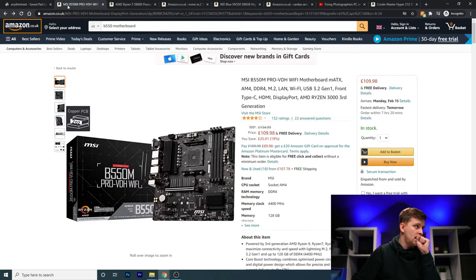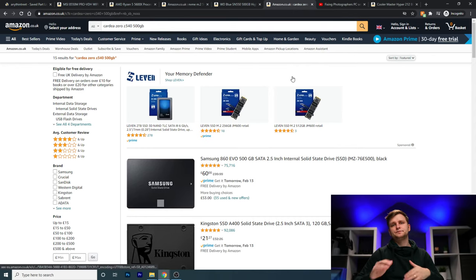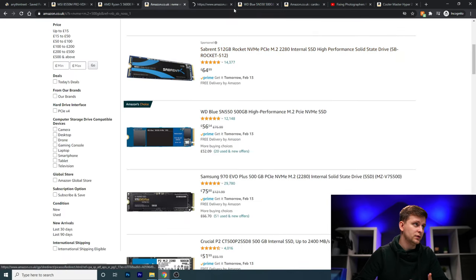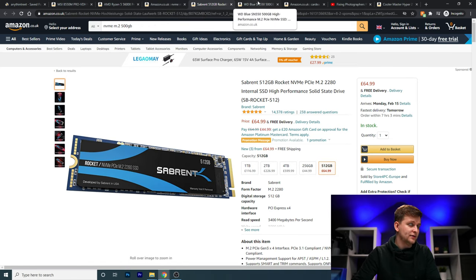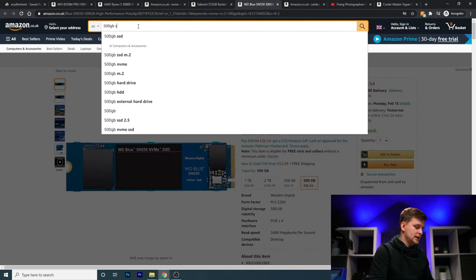Now, where are we next? Yes, the SSDs. So this is how I would set it up. First of all, you get either this one or the Sabrent Rocket one. I'll leave the links in the description as well if people want to check that out later on. I know I forgot to put the SSDs over here. I set it up quickly. But this is what I would go with: OS drive on this one. Then for your cache drive, you can save a little bit and get a 500 gigabyte SSD.